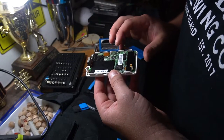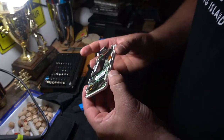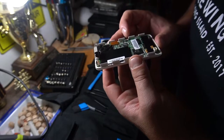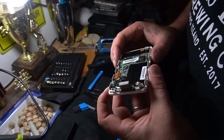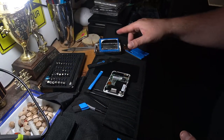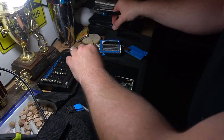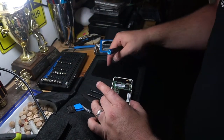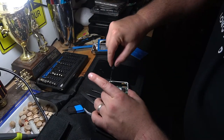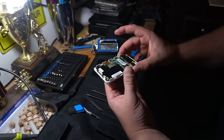There's no physical signs of water damage, and clearly the connectors on each side are in great shape — so it hasn't really been opened before. I'm going to remove these screws: one, two, three, four, five — looks like six screws to get underneath the motherboard to replace the screen. What's great about this iFixit kit is this pad that has a magnet in it for holding screws. I've got the six screws out — let's go ahead and rip that out.